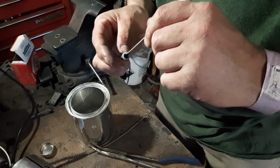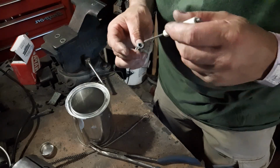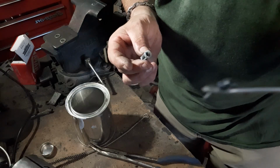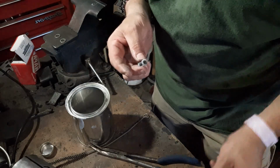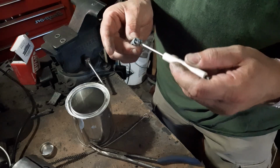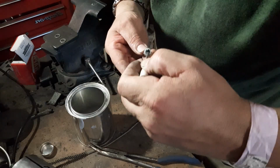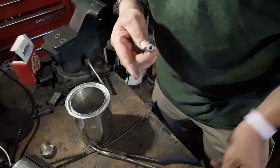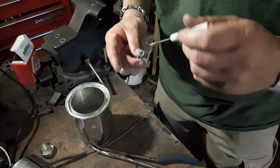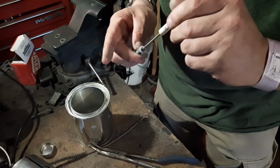Very gently, because remember, that's a fine mesh screen. I mean, there's blue paint from the shop truck. A lot of clear, because clear leaves a residue. But you can see the crap that I'm getting out of that filter. So we want to make sure we get that out. There's another big glob of it. So old E's not doing a good job here with being clean. So that's something I need to work on with future paint and just in general.